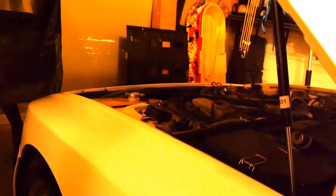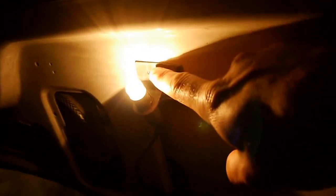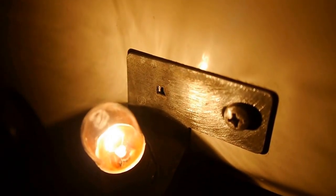When I put the light bulb in, I had continuity — I had voltage going to the socket — but it never lit up. So I had to disassemble the light bulb socket, pull the wire out, clean the mercury switch tips on either side, and clean the cap and the inside. After you pull the mercury switch out, there's a little tab where it connects to. I cleaned all that, and now it's a nice shiny connection, and it's grounded.